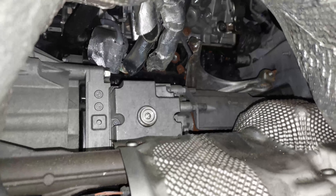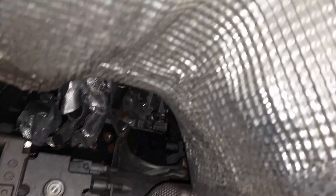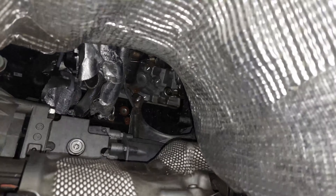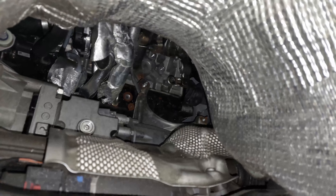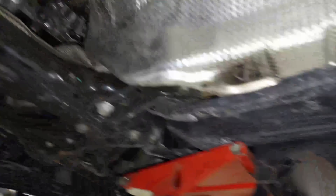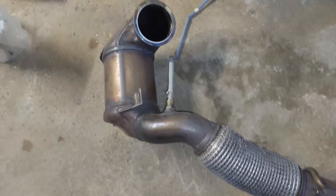Here's the back view of how the two block retention screws look that hold the OEM downpipe. This little pesky thing right here is what you have to struggle with, especially when you have the automatic transmission in the way. I went from this side using a mega extension — once you visualize using that extension and putting it over on that bolt and loosening it from here, you realize how easy it is. Removing the downpipe was a little bit of a struggle too — you've got to push up on it as you're removing it because it'll get stuck on this corner. By pushing it up you're leveraging it over, then slide it from underneath. Removing the center brace bracket helped give full movement. That's the factory downpipe — see you later gator.